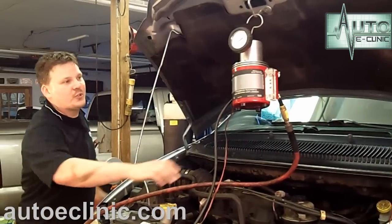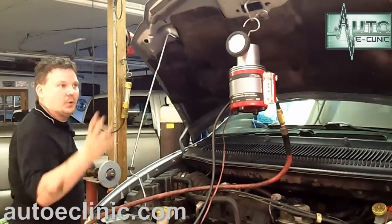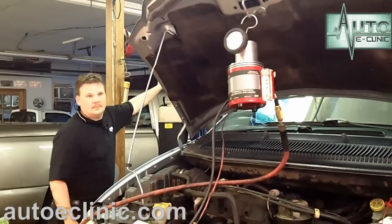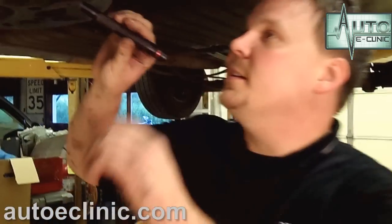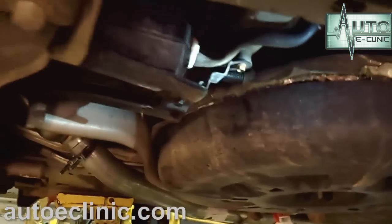Okay, looks like our job is done. You can see now we have the smoke machine reconnected — we're retesting to make sure the canister's not leaking. We're going to raise it up. We're injecting chemical smoke into our EVAP system. We have our new canister installed, and we have no smoke coming out of this canister. It looks like we have fixed the vehicle. Love the chemical smoke.